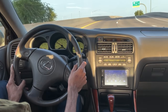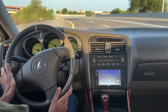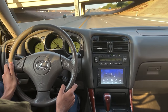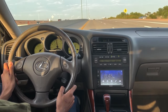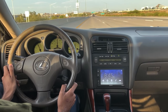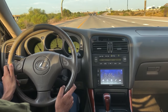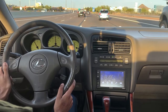We now move from the streets to the highway — this is where we'll really be putting the car through its paces. A highway merge is a good chance to do some spirited driving. Push the accelerator pedal all the way to the floor after making sure it's safe to do so — the car should downshift almost instantaneously and you finally get to hear the famous 2JZ growl. Keep monitoring the tachometer under increased stress: the RPMs should rise smoothly and shifts should be almost imperceptible. It's okay to feel a slightly jerky shift while flooring it on higher-mileage GS 300s, but you don't want to hear weird noises, delayed shifting, or the whole vehicle lurching violently.